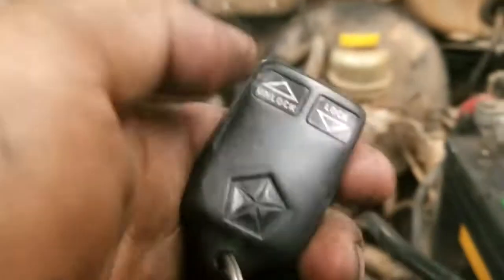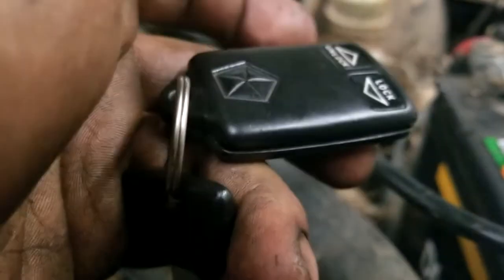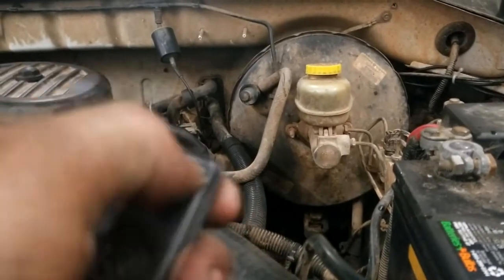All right, after many trial and error, I took the batteries out of this thing, kind of bent the tabs forward because I wasn't making connection. There are two 3-volt batteries in here, and the voltmeter showed it was making 3 volts. So I figured, why would they be dead? So I made a little better connection for them, and now, if you can hear that, I got electric doors again. Well, actually, for the first time, I never actually had this working. And you just have to hit unlock when you first hook up the battery and silence. All right, now that we got that figured out, let's figure out if this thing makes oil pressure.